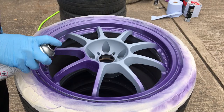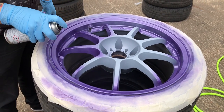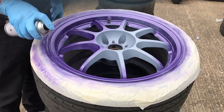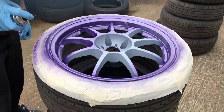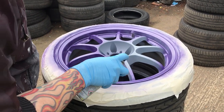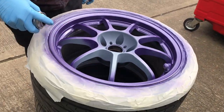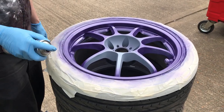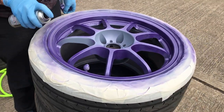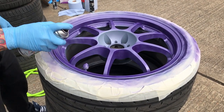I tend to give it a coat and then go over it one more time with a really fast coat. This process — painting on top of primer without sanding — is called wet on wet. As the primer dries, give it about 10 minutes and then feel around the edge where you've got overspray on the masking tape. If it's touch dry and doesn't come off onto your finger, go straight onto the base coat. Don't waste too much time — if it dries too much it'll peel, and if it's too wet it may react.